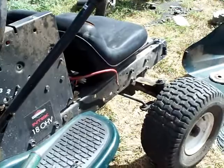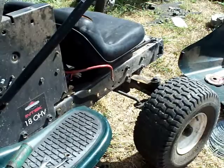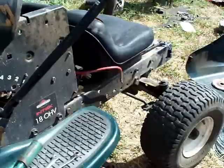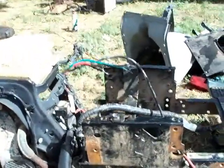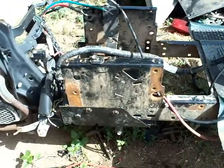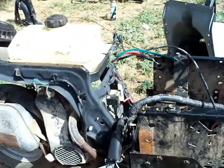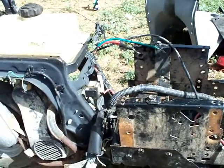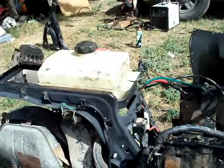I am going to build a complete suspension system for it, but I wanted to do something to test it yesterday. So with that done, I fired it up. I got the fuel tank mounted and tubed in, and put the battery in from the mower and fired it up. And I still had some carburetor tuning to do. Matter of fact, I got junk from this tank in the carburetor, which caused problems. I didn't have a filter in it because I was trying to get it together. So I've got to pull the carburetor off, clean the float pin and junk out of the carburetor, and clean that fuel tank, and then get a filter in the line.